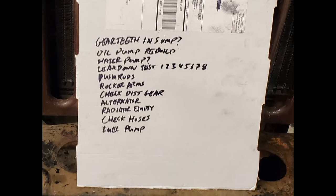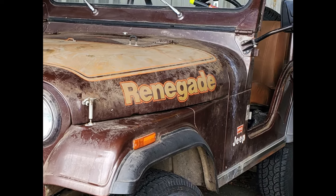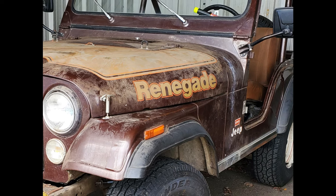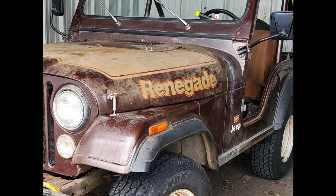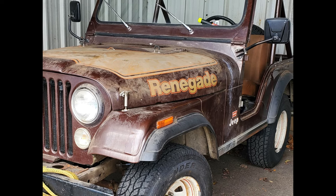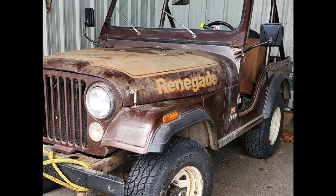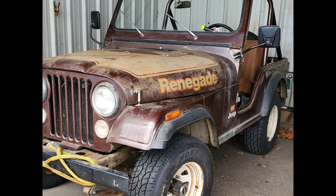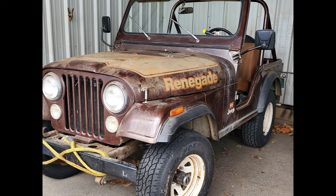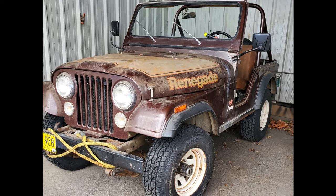Here's my list of things I needed to look at when I pulled the front of the engine apart. I've done all those now and I'm going to do a second video showing that process, but suffice to say I didn't actually jump the timing chain. It was actually the distributor gear that was chewed up, so I didn't end up having to deal with the valve train — everything there was still in good shape. I'm going to put that footage together for a second video, but this one is already almost 19 minutes long. Believe me, the Jeep runs again — at this point I've put about 80 miles on it, no more problems. So the lesson here: this is how far I got in the first 10 weeks — from not running at all to running and driving and then not running anymore because I didn't put any lube on that distributor. You need to put assembly lube on any gears that are going to run when starting up from sitting for a long time.